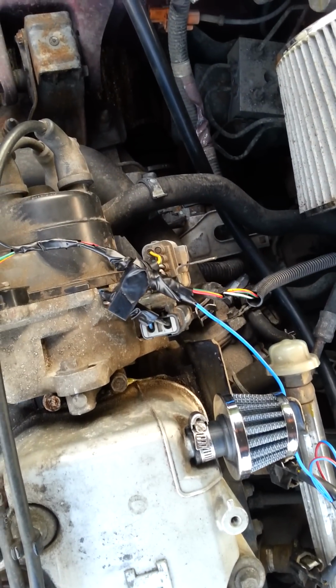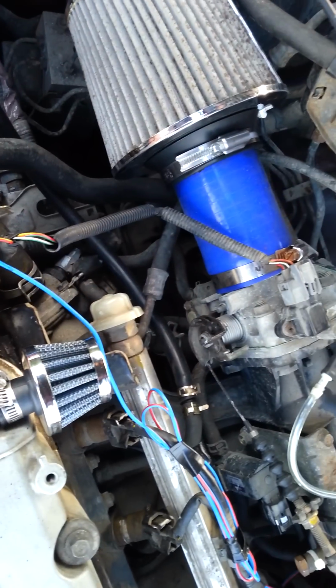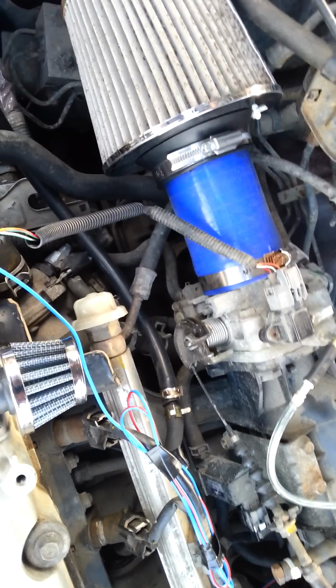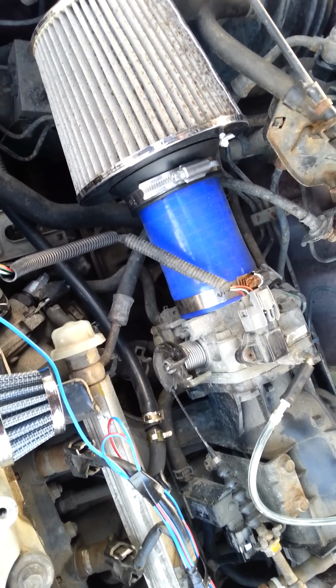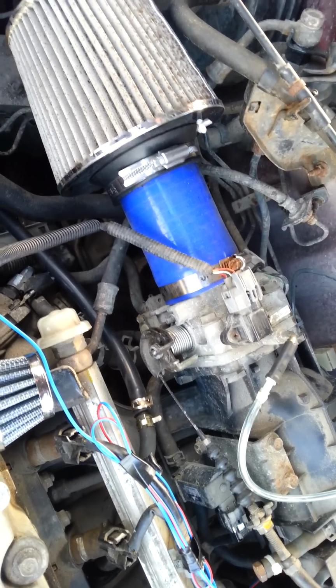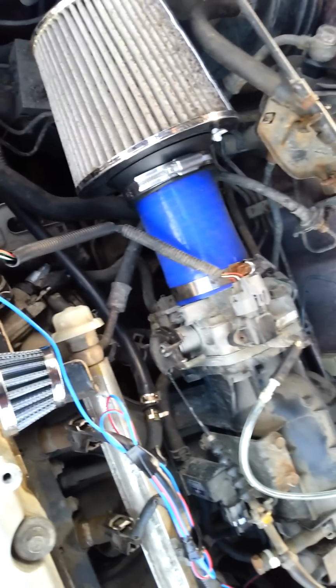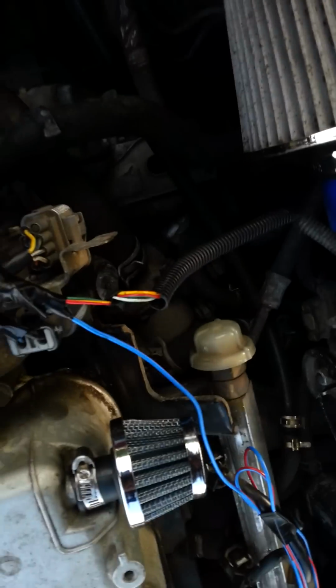So yeah, what else are we getting back to? If you were doing that, you wouldn't have this coming here. You'd probably run another wire back into your car, connect it to a permanent 12 volt feed, like just off the ignition barrel, or a 12 volt feed to a bulb in your dash or something like that. It's the easiest thing that's got a constant 12 volt, and then obviously the button would give the system 12 volts, and you could let go when you didn't want launch control. So I will show you how it all works. I have to just pop into the car.